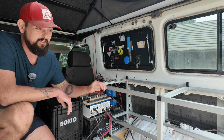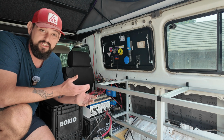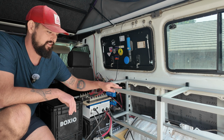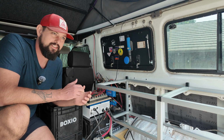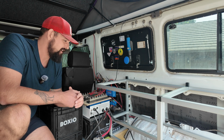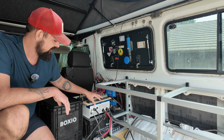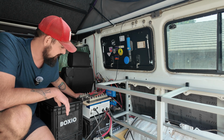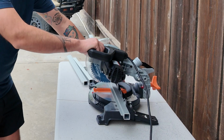And then for some of this mounting, I'm toying around with the idea of actually drilling and throwing some riv nuts in here. I'm not going to get crazy with it and turn these aluminum extrusions into Swiss cheese, but I think if in a couple of places I drill and set some riv nuts, then I can make some really good connections for things that need to mount up like this. I'll probably drop riv nuts across some bars to hold the inverter, and then I'll be feeling pretty good about things.